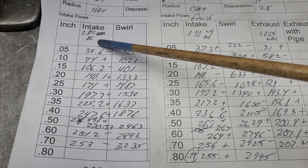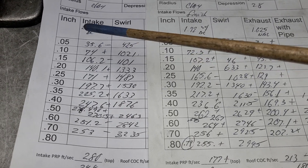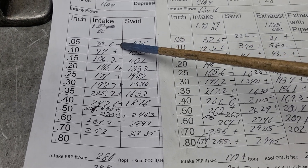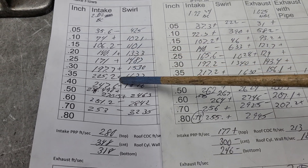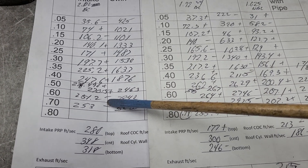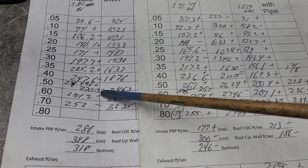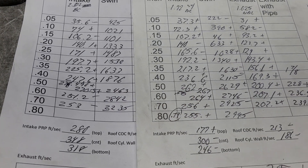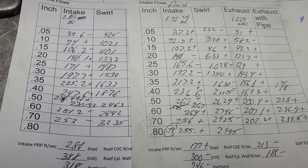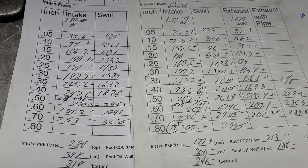This head basically has the same port but has a bigger valve, so I had to adjust the bowl to fit the bigger valve in, and obviously do a valve job. How'd we do? Loss, plus, plus, plus, plus — until we lose it on the short side. Remember, the bigger valve gives it more area, so the short side is more difficult to keep under control. That's what happened on the Chinese EQs too — small port moving a lot of air and the short side speeds were just insane. Our short side speeds are quite high on this one too.